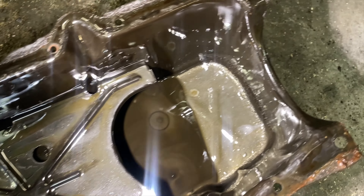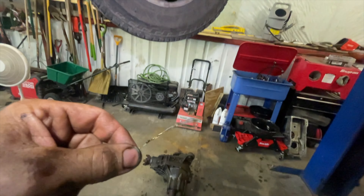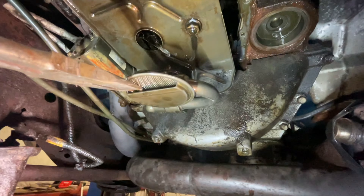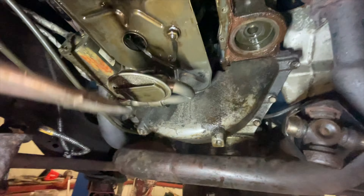Pull the oil pan down. You can see the metal flakes glistening in the oil pan. Look up in those corners - you can see right there. There's a nice chunk of bearing right there. Look at that - that's a piece of a bearing. We're seeing this together for the first time. There's a piece of one of the bearings that failed. I'm hoping there's only one bearing that's bad, but who knows? It looks like it got sucked right up into the oil pickup. Oh yeah, all kinds of pieces up in there. So we're going to make sure to clean that out.